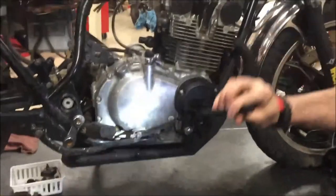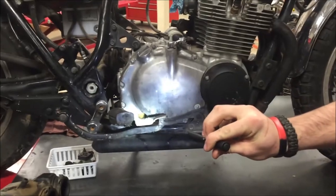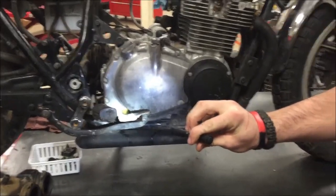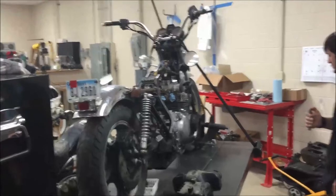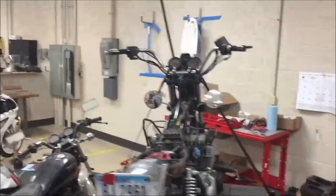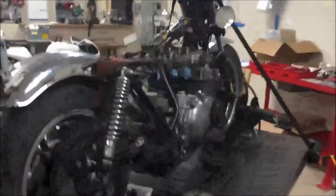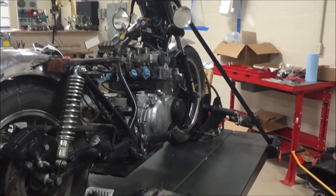All right, we're gonna do "Every Mechanic Should Know" again, and that's on checking oil levels. So we're gonna do a typical sight glass motorcycle here. I'm gonna back up so you guys can see how this bike is tied down on the lift. You can see that it's significantly pulled off to the left side. Our problem is that per the owner's manual of this motorcycle, it needs to be straight up and down. So we're gonna go ahead and straighten those tie downs first.